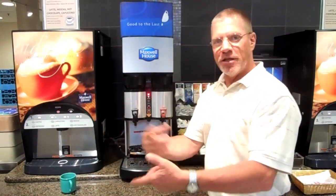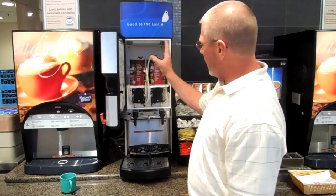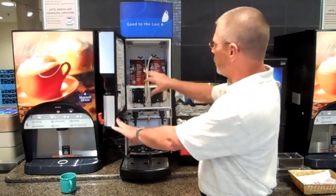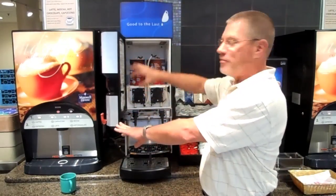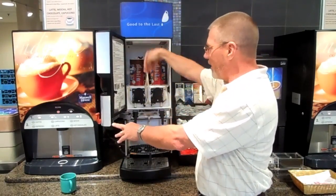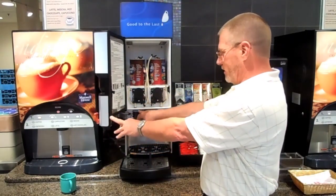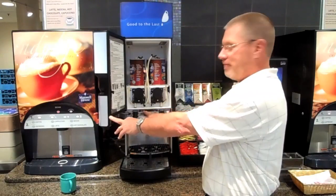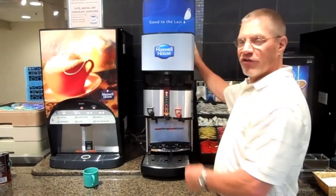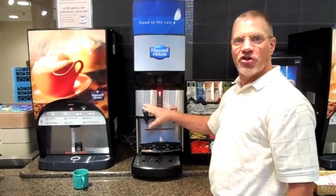This kind of helps to speed the process up if somebody doesn't want to stand and wait. As far as maintenance on this machine, inside is basically the refrigeration unit like the other machine. This one you can keep two cans of each, so you always have a backup. In the middle of a meal period, if the first can runs out, you simply take that out, pop the next one, stick the probe in, and keep on going. Same kind of switches: rinse, normal, and prime on one side; run, off, and night on the other. Night keeps the refrigeration unit on, keeps the hot water tank on, but deactivates the buttons so you can't get coffee.